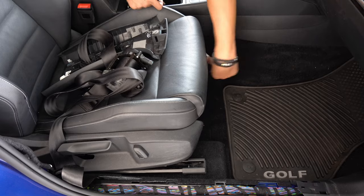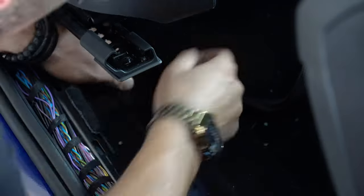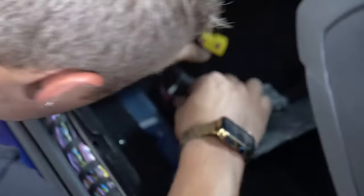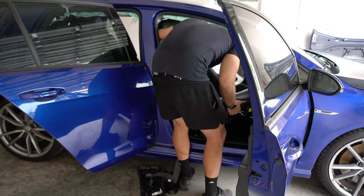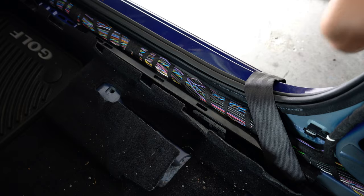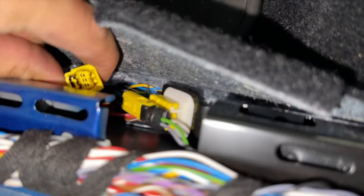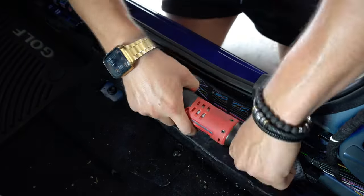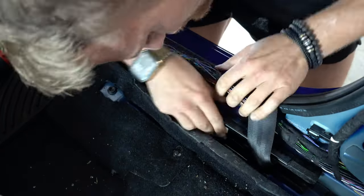There are a total of four bolts around the seat that hold it to the floor — those obviously have to come out. Then I can tilt the seat back just enough to access a little secret compartment below the carpet, which uncovers three connectors that send power to the seat, the airbags in the seat bolsters, and probably the heating element for the heated seats. With everything unplugged, I could pull the passenger seat out of the car, revealing even more seatbelt components than I originally thought. Underneath the carpet is the pretensioner, which has another detonator plug at the end. It's screwed down by two more M10s and a few plastic clips connecting the wiring harness to the top of the pretensioner. With everything unplugged and unclipped, you can slide the pretensioner back and it just comes out.